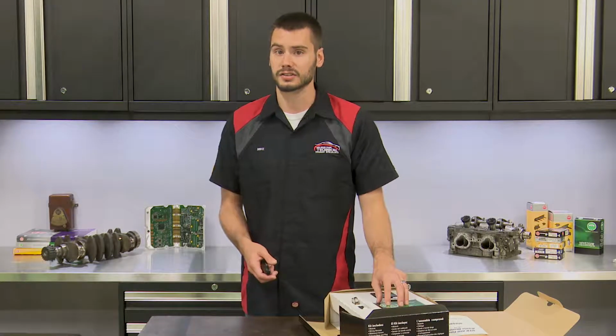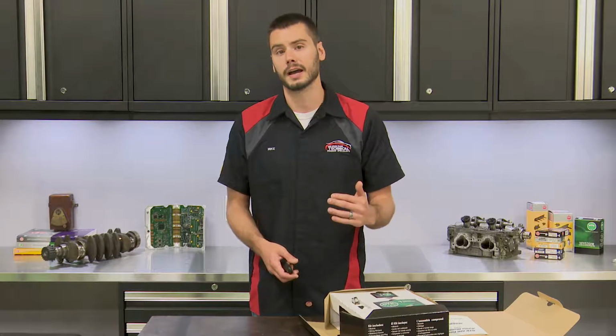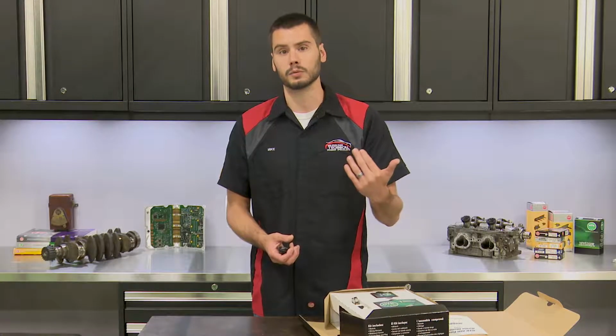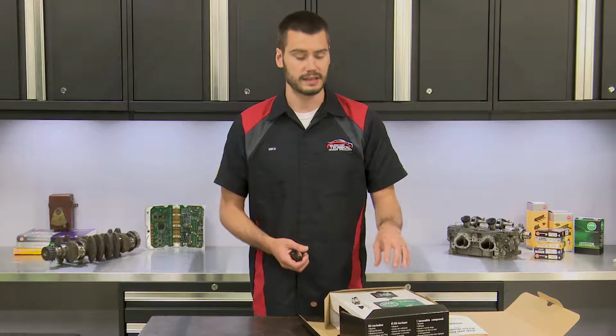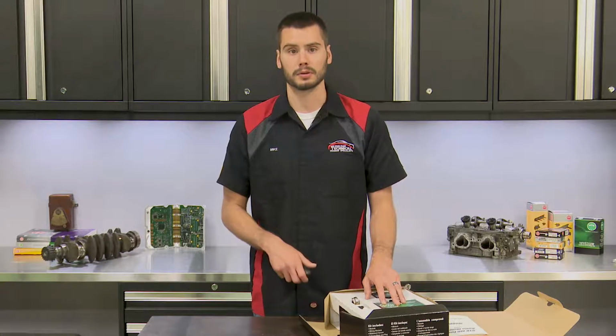because unlike a standard oxygen sensor, an air-fuel ratio sensor needs to be heated all the time in order for it to function. A lot of standard O2 sensors really just need that heater to get it working, and then it'll continue to work. This needs to be constantly running in order for the AFRM to work properly.